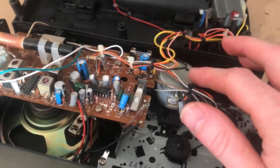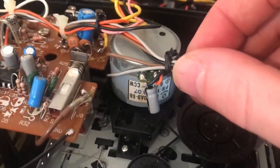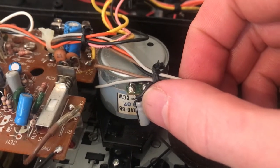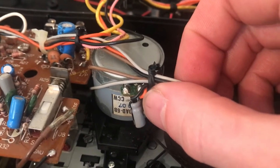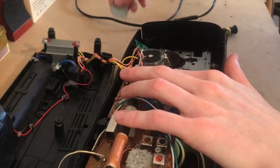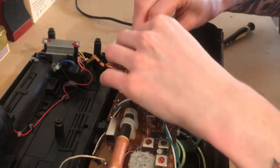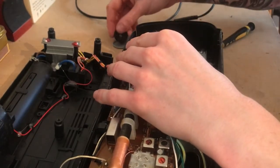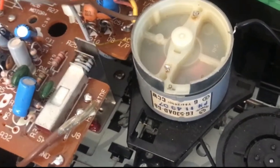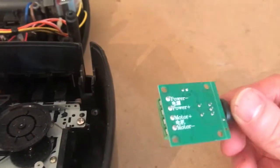This is the motor for the cassette. As you can see, there's a little bit of circuit board popping out of the side, and there is a red and a black wire — we're going to need those shortly because those are coming from the power supply to the motor. We want to pop that top cap off the motor, which will expose that circuit board, and we are going to remove that altogether. The top cap can be prized off, and this particular circuit board had two solder joins holding it in place. With the circuit out of the way, we can see that we have two terminals on the motor itself.